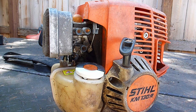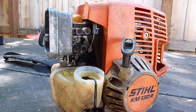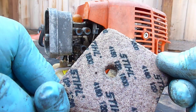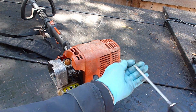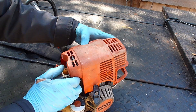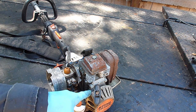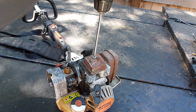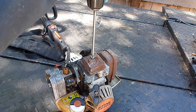We'll start with the air filter as always, and the gas tank — completely empty. The fuel smells terrible. The air filter looks great on both sides. We'll take the engine cover off. Push in at the base of the spark plug boot to get the engine cover to slide off. It looks really good down in this area. Normally that's where the crankcase pan glued seal is leaking and they'll be slinging fuel and oil into that area, which makes them all packed full of debris. So far so good.